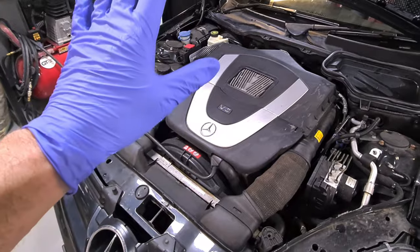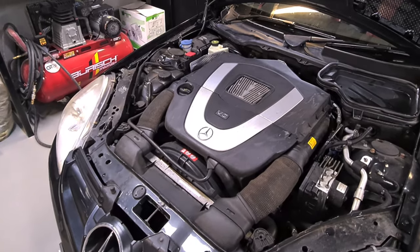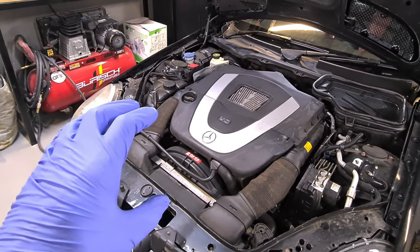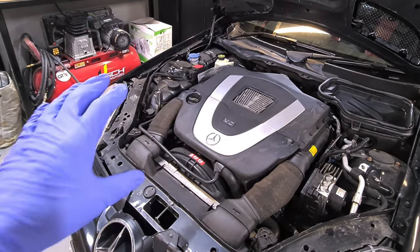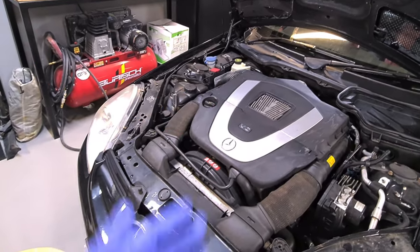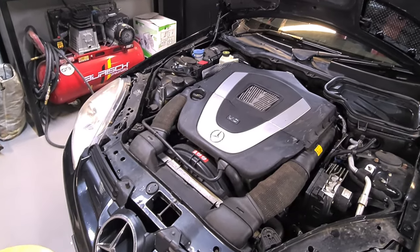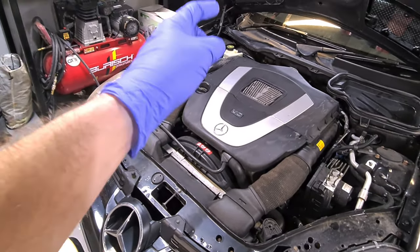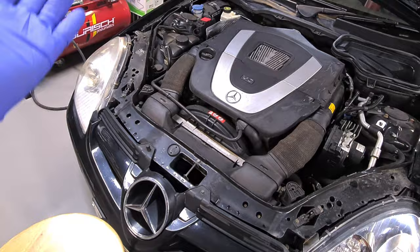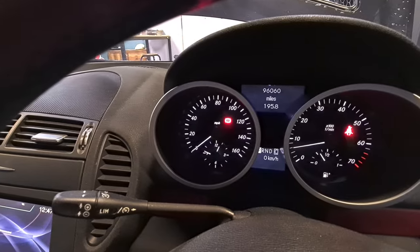So what's happened to this car? We've had it for a year and it's run perfect throughout. Suddenly one day we come to fire the car, drive it away, park at the traffic lights, and we can feel a shudder every second or two in the seats. The engine starts to die and we notice a flutter and drop in the idle. But when we apply some throttle the car runs fine, which makes me believe it is aimed at the ignition coils or a spark plug. We're going to take this apart and I'll show you how to diagnose the problem — you can use this on any ignition coil.